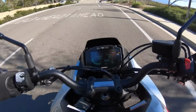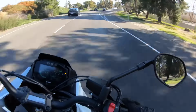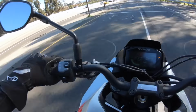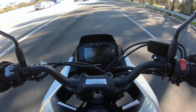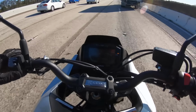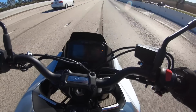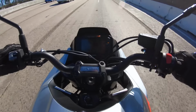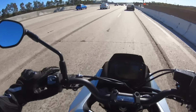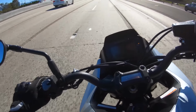Great, another turn, guys. I love turns, especially on the Suzuki Katana. This Katana is rolling on Dunlop's Sportmax Roadsport 2 tire. The Roadsport 2 tire is designed with extra silica in it, so it's going to perform a little bit better in wet and cold conditions. 120/70-17 front, 190/50-17 low profile rear. Generally I like 55 series, 60 series rear tires, but this 50 low pro tire really fits in with the aesthetic of this bike. And even with that lower rear tire, this bike still is pretty agile. I'm really impressed with how maneuverable it is.